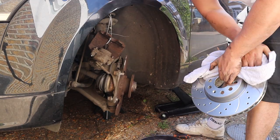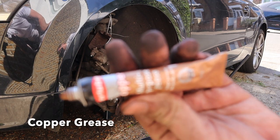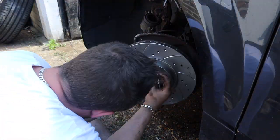Now let's clean up this brake disc of any oils that may have been on it for storage purposes, and use a little bit of copper grease on the hub. You want to sand it off and make it nice and flat, but the previous person had already put a bit of copper grease on it so it was fine.